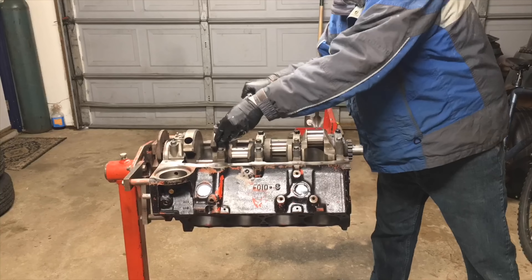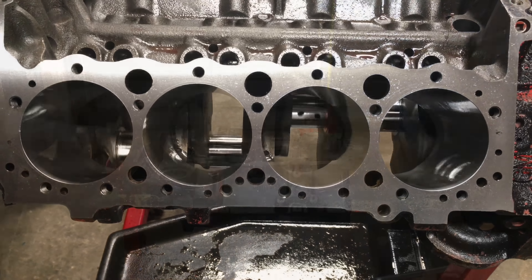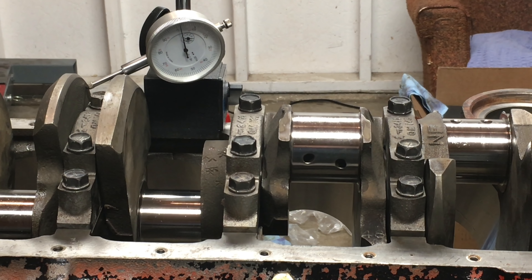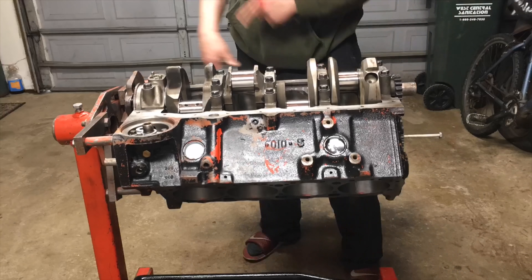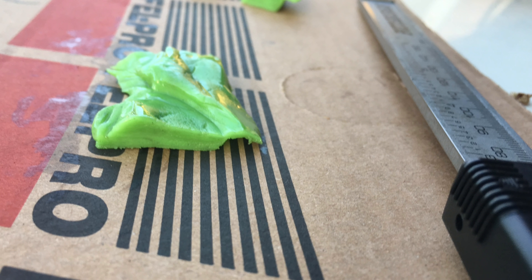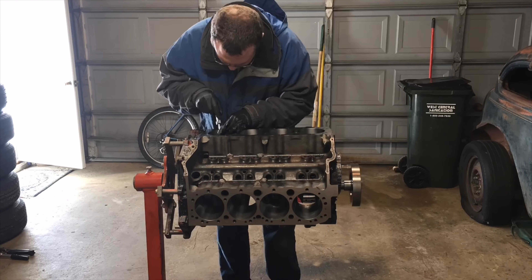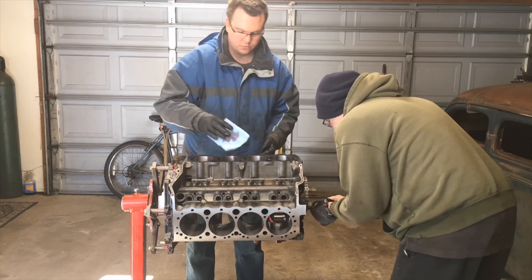After torquing the crankshaft, we're checking the thrust — the forward and backward movement of the crank — with a dial indicator to make sure it's within spec. Next, we're checking the piston-to-valve clearance. We do this by putting some Play-Doh on the piston and setting the head on the block, lashing the valves and turning the engine over a couple times to make sure both valves open and close, then pulling the head off and measuring the amount of Play-Doh between the piston and the valve. Once we're happy with that clearance, we check the piston ring gap for each cylinder by inserting each ring into the cylinder, squaring it up with a piston to make sure it's flat, and checking the gap with a feeler gauge. Once the piston rings are all gapped properly, we can assemble the short block.